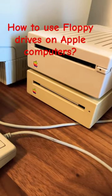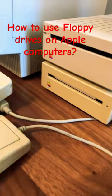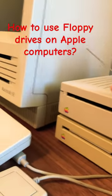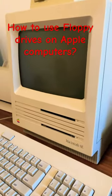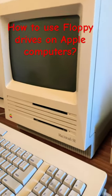If you're going to buy an external disk drive for your retro Mac or Apple II computer, you're going to need to know a few things. Depending on what type of floppy drive your system originally came with, that'll decide what type of floppy drive you'll be able to use externally. Since my SE comes with an 800k floppy drive, I'm going to need to buy an external 800k floppy drive.